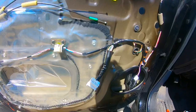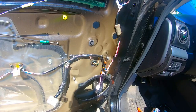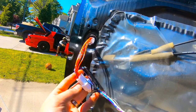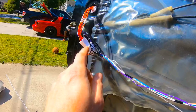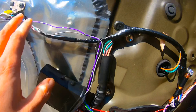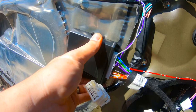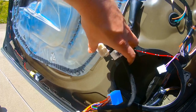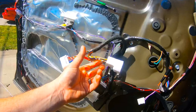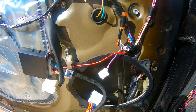Here's what I've got so far: I disconnected that connector, plugged it into the T-harness right here, and then plugged the harness in. I've got this tied up with some bread-tie-looking things that came with the wiring just for now so I can clean it up. Here's the module — I'm going to try to mount it right there. I still have to hook up this connector into this T-harness, and then that connector goes into the controller. The red wire you've got to run to your battery is for Tundras that have auto down but not auto up on the driver's side window.